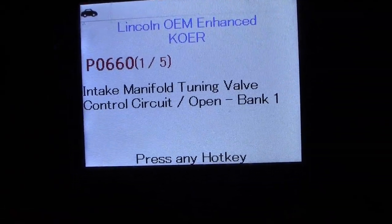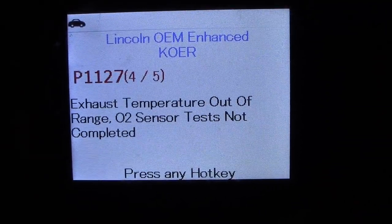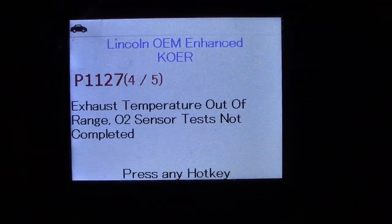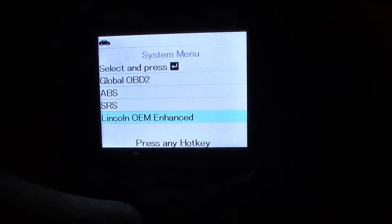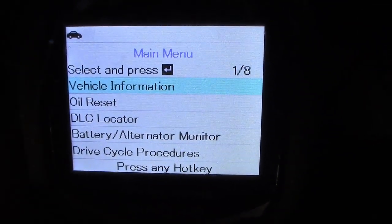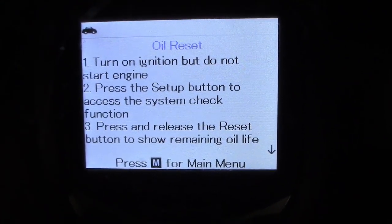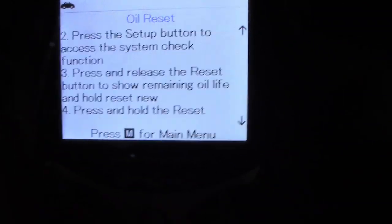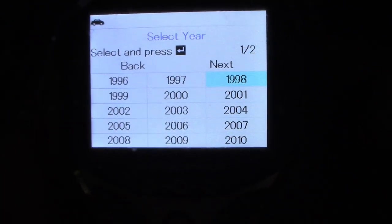It's running through it and we got a couple more codes. It's not fully warmed up, so I'm getting an exhaust O2 code. That's pretty cool — obviously temperatures because it's not fully warmed up, but that was definitely pretty decent. Didn't take very long for key on engine running. To go back, you just hit system and that takes you back to the main menu. Hitting menu, it's got oil reset — this car probably supports that or at least tells you how to do it. It also tells you where the OBD port is on what car. All that information is within the tool.